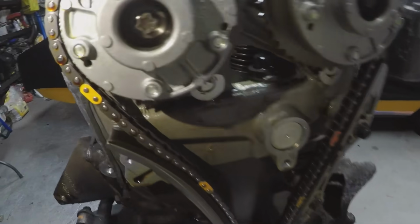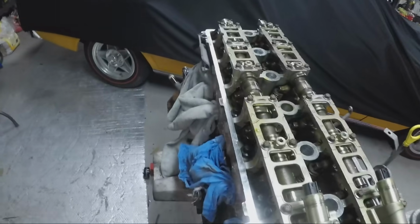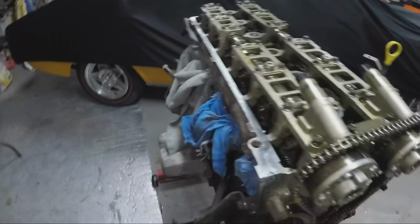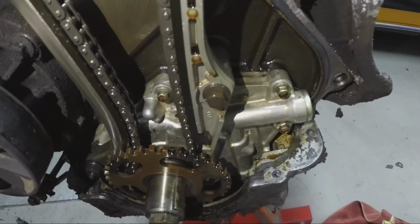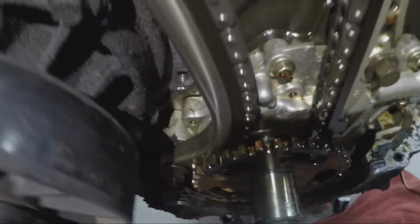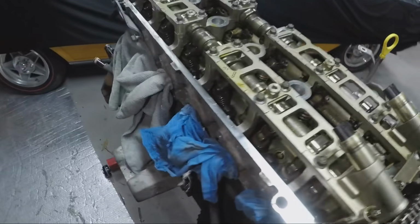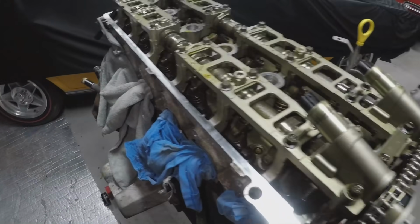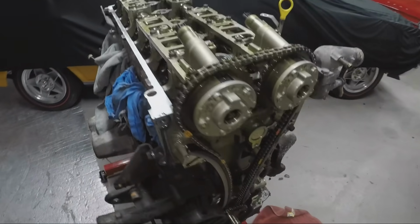As I said before, pulling the full chain off, the sprocket down there, the cams, caps, and everything's coming off because this engine is getting fully rebuilt. And in tomorrow's episode or the day after, we'll be replacing the oil pump gears with billet oil pump gears, because as every FG owner knows, they like to go rat shit after 300 kilowatts and a lot of limiter bash. So we'll get them changed out. I'll get the valve springs changed out and the head studs, rebuild the engine, and then it's ready for boost. So I'll keep you posted now.